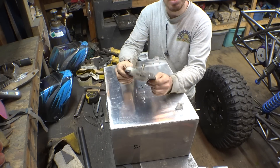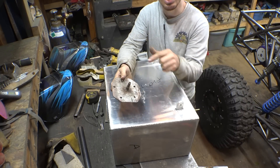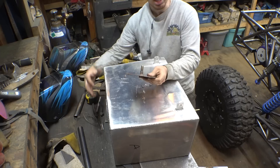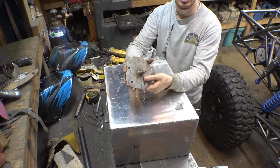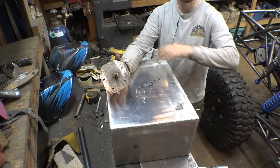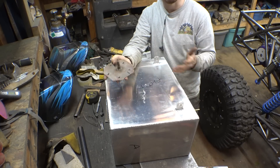I found this — I can't remember what I made this for, but it has the same bolt pattern as the mount for the fuel pump for this gas tank, so that's awesome. We can put this on. It has a spot where we can put a hose on here and pressurize this thing, and just spray soapy water on it and make sure nothing's leaking.